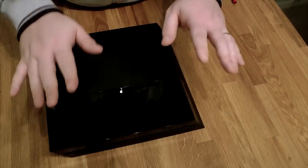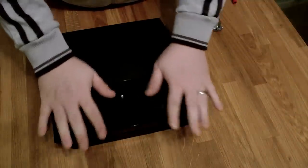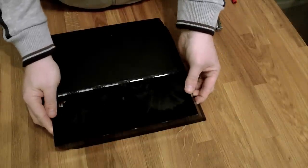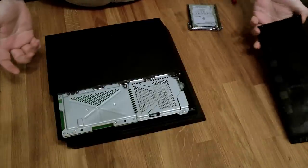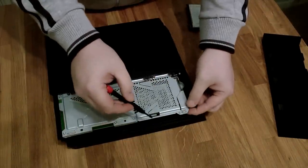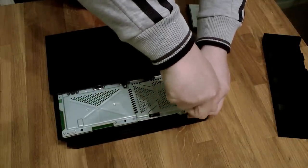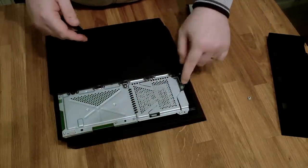Apparently this is nice and easy. What we have to do is slide the black glossy bit off the top — the easiest way is to give it a lean and just push. It unclips nice and easy and it's off. Then we have a little screw in here — you're looking for the screw with the PlayStation symbols around it. Get the screwdriver in there and it came out very easily.